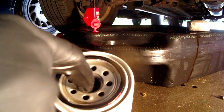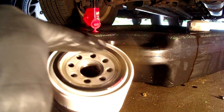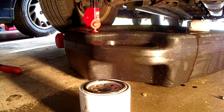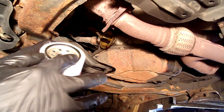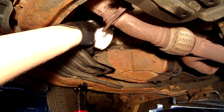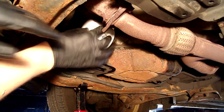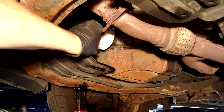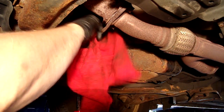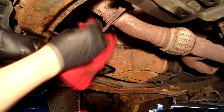We're going to grab some of this oil we used to prime with, put it on our finger, and run it around the gasket here — make sure the gasket has oil on it and is clean and free of debris. Now take the filter, maneuver it up carefully so as not to hit that rubber gasket on anything, and start it by hand. I like to finish tightening it with a rag in my hand since things tend to be pretty slippery.